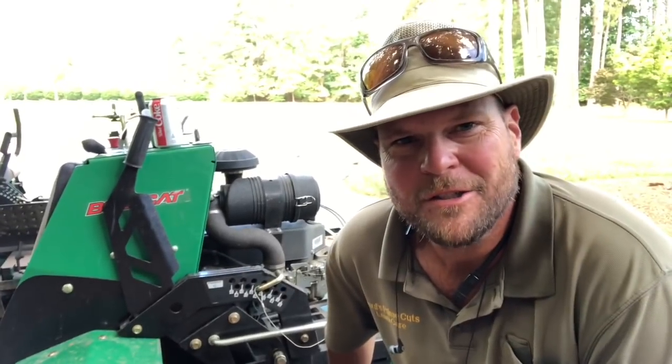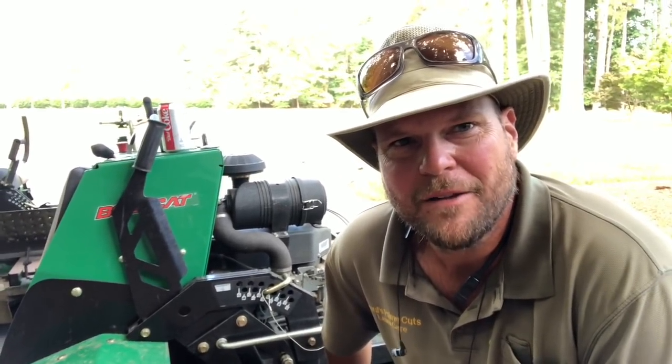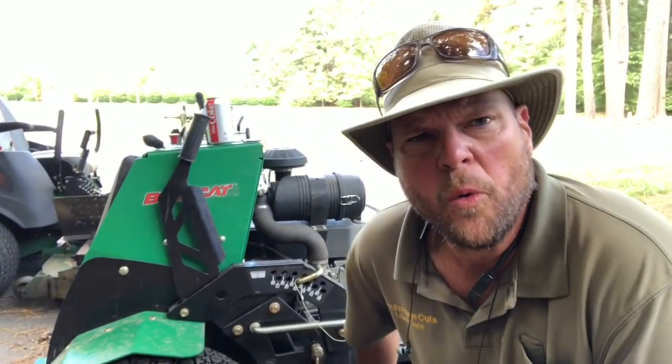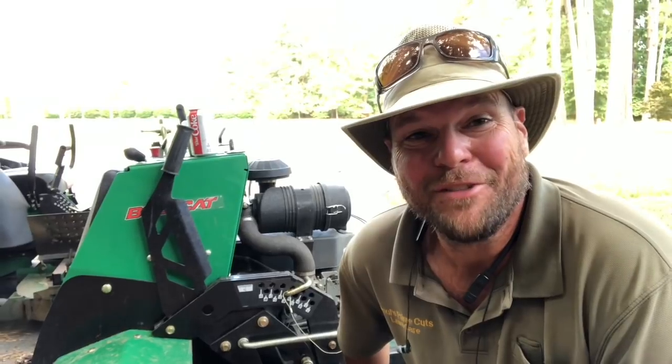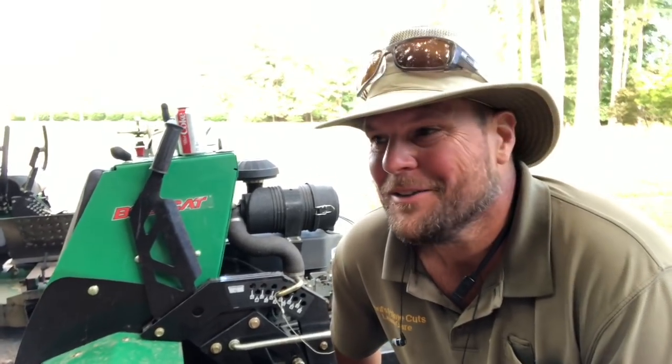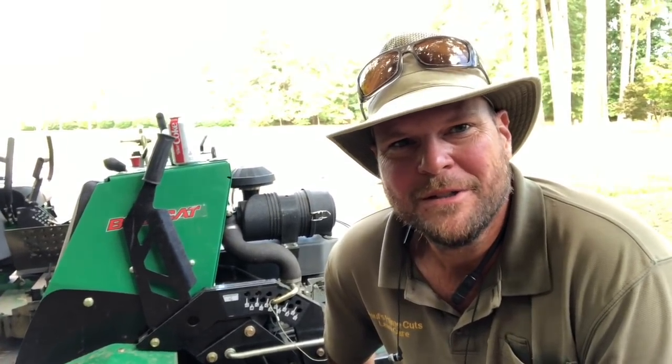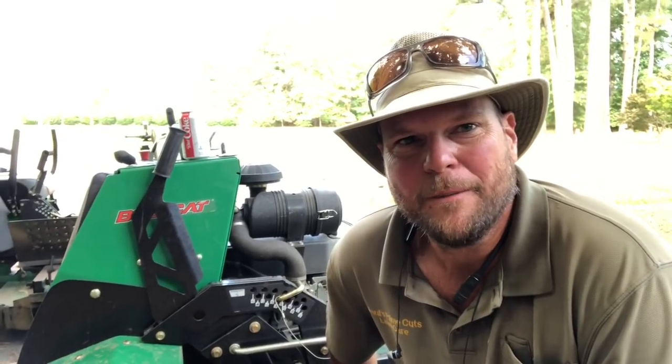Okay, I tested the flap out at my house in the Bermuda grass yesterday when I got it put on. It didn't work too good. It's too stiff, and I got it a little too low, so it kind of raked the yard, and it's stiff enough that it holds the deck up. So I either have to shorten it up, or maybe this just won't work for a mower that's going to go across several different turf types. But I've seen proof that it works pretty good on just a straight fescue yard.